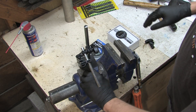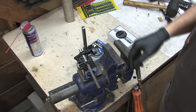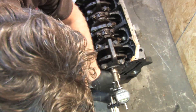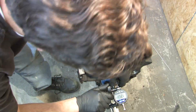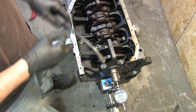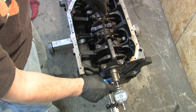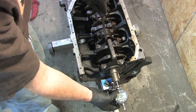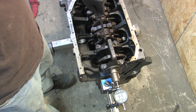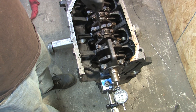It's best to use one of these cool magnetic bases — great for trolling five and six year olds. It has an on and off switch that actuates a 45-pound magnetic base. You let them pick it up first and get a feel for it, then flip the switch — suddenly it becomes heavier and they can't pick it up. It's handy because you can mount it to iron or steel at any angle. Once it's in position and the crank's at the end of its travel, use a small pry bar or big screwdriver. Don't apply excessive pressure on your mains — just pry it lightly to the end of its thrust clearance. With everything in place and the plunger touching the crank, zero the indicator, then move the crank forward and take your measurement. Move the crank backward and make sure the tool zeroes. Take this measurement several times to make sure it's working properly.